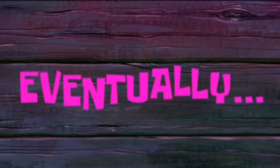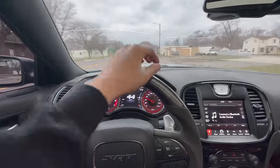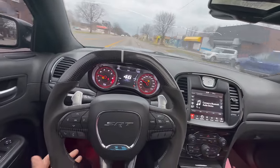Yeah, something's loose. I didn't tighten something. All right, y'all, I fixed it. Come to find out, I didn't have the sway bar link tightened down all the way. It was tight, but it wasn't tightened all the way. So every time I hit a bump, it was just rubbing up against the shock. Got that fixed. I do need a wheel alignment on this car, then I'll be 100% green.